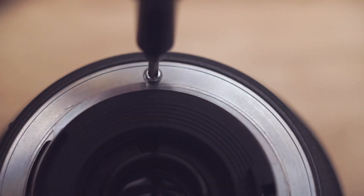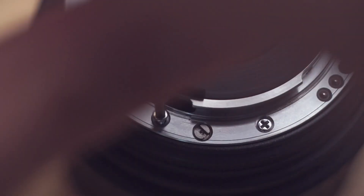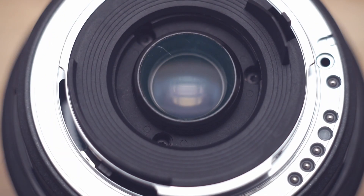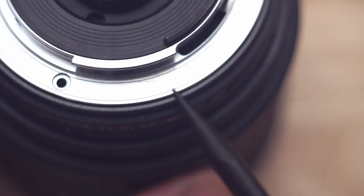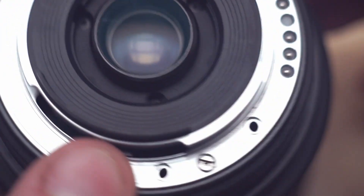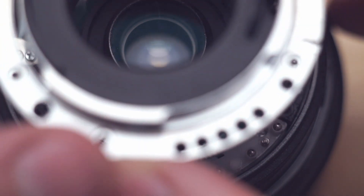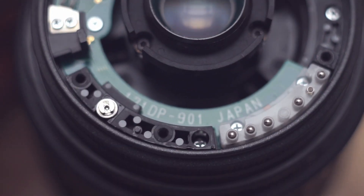I've had this lens apart a couple times now during my attempts to fix it, so it's kind of used to being taken apart. But that very first time, likely since the factory, it might not be a bad idea to take them off one at a time. Before I take anything off, let me tell you a couple things you're going to want to know. There is a little spring right behind this blanked-off part where there isn't a pin connection — on the opposite side from where those connectors are, there is a ball and a spring. If you're unlucky, when you lift this off it's going to go flying across the room. And then when you lift it off from this linkage, it gets stuck because that thing right there gets stuck on that brass pin way down there.